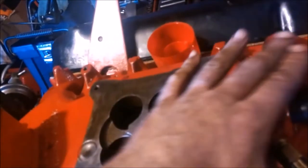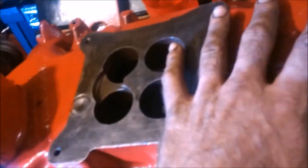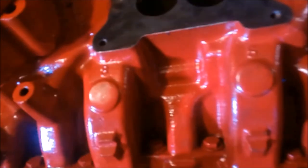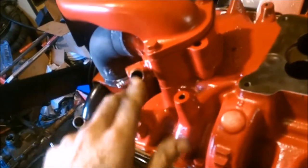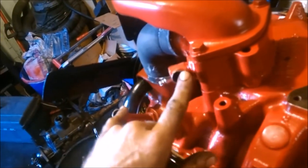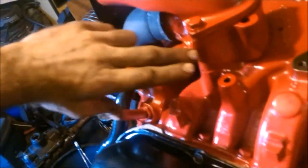That fuel line will route up to our carburetor. Use the four-hole gasket — see here where it's not going to mate: put the gasket on and cut that out, otherwise that part's just going to rot. Or use the big gasket as a heat shield to keep heat from rising up into the carburetor, mostly caused by that port. Sometimes you'll see that fitting moved to the back of the manifold — there's no reason since the hose has to go around anyway. While it's on the stand, that's all we can do for now.